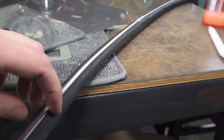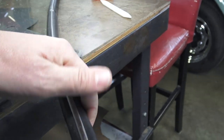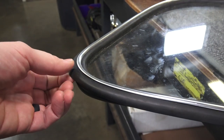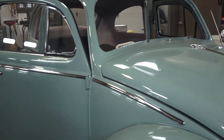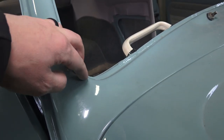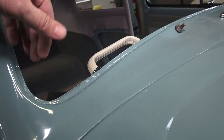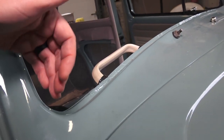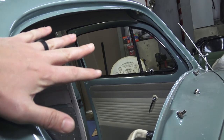They're a little bit thinner - the flap doesn't come out as far, especially in the corners. You'll notice sometimes when you install the windshield the corners want to tuck in and don't want to rest flat on the body like they need to. A lot of times after installation the seal curls under. There is a fix - Wolfsburg West even has a video on this. You get a small block of wood, place it on the rubber, and hammer very gently to push the seal flat.